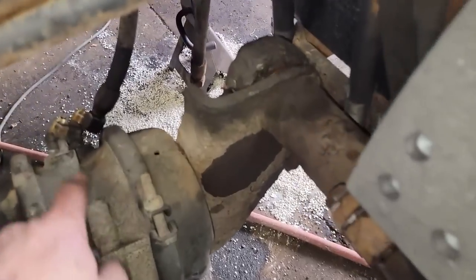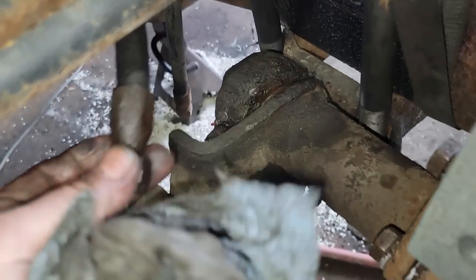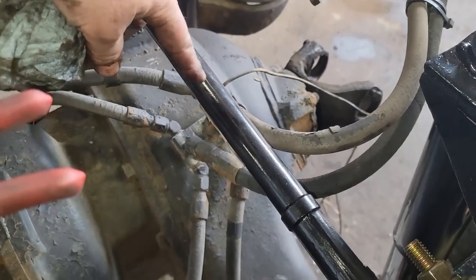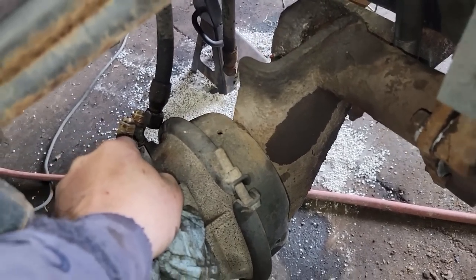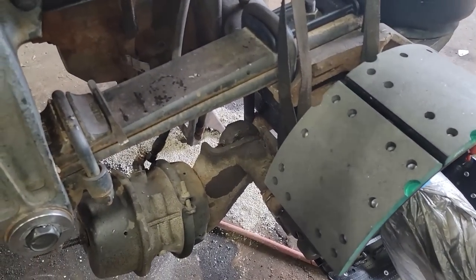In there. The next thing I want to do is start getting these fittings out of these brake chambers. We're replacing them with hard plastic lines because these hoses are all dry rotted and cracked, and they're a real pain to get off of there. So this axle moves with, you know, this stationary mount here. The only place we need a hose is from there to the valves, you know, that's all. So we're gonna go ahead and get rid of these. I'll probably have about as much money in new fittings if I don't have the right ones for compression than I will have making hoses, but at least we won't have to have hoses replaced again.